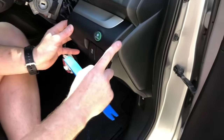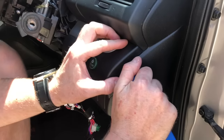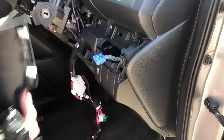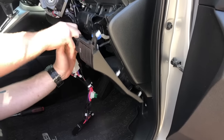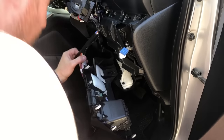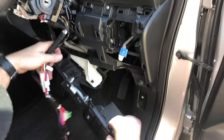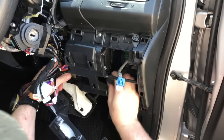We're going to remove this panel first — there's a little cut-out section. We'll use our pry bar to pop that section off. We also levered the left-hand side at the back, undid that plug with the little locking tab, and pulled the rest of this section off. All locking tabs — very easy. On the back of this switch, if you have traction control or any other switches, those will come down. That allows us to mount the module behind here and tie it up nice and neat behind the shroud or the undercarriage of the driver's side. That is our completed job.